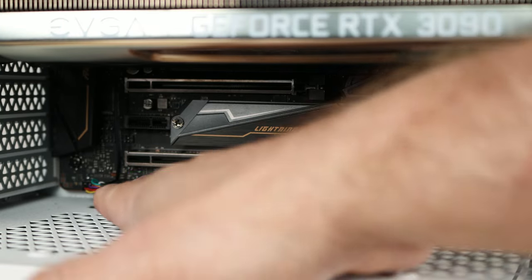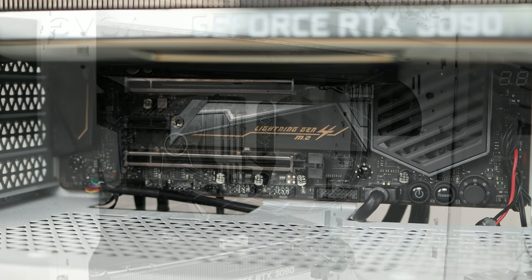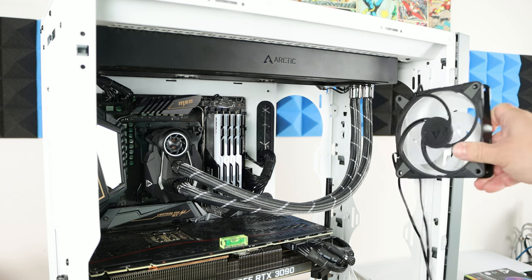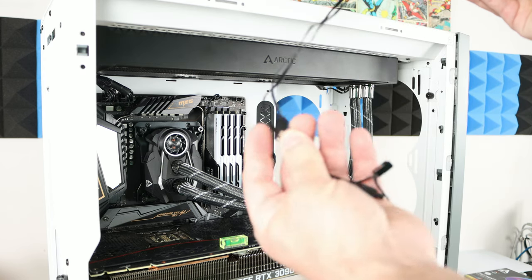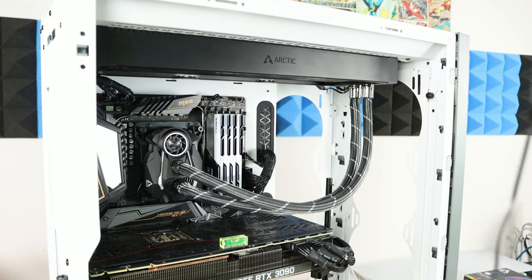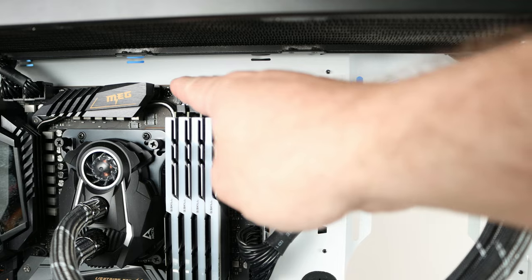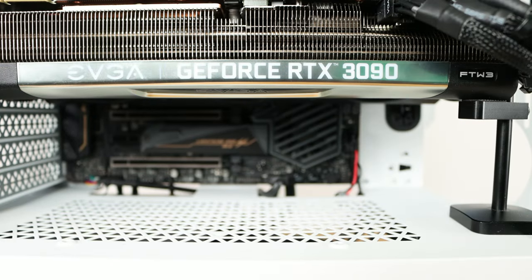Along the bottom we have two more headers we can utilize — four free headers total. If you have a different motherboard you might have more or fewer, but you can always buy a fan splitter. For the front of the PC I'm going to place a fan and screw it in with all the cables dangling to the side, so I can join them all into one cable and connect into one fan header and one RGB header on the motherboard. Note that not all motherboards have RGB or ARGB fan headers.